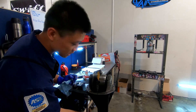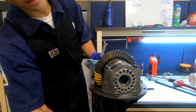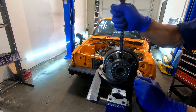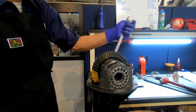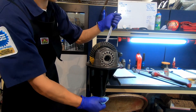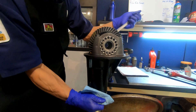All my bearing preloads are set already — you can see this takes a little bit of force to turn. What I'm going to do is roll this just until the gear paint hits the ring and pinion, then on the ring gear side I'll use my wrench for leverage and roll this thing back and forth. While rolling back and forth, I'm going to simulate load by grabbing the pinion flange itself and applying pressure, simulating a load on the gear set.